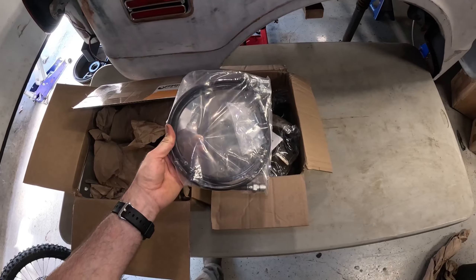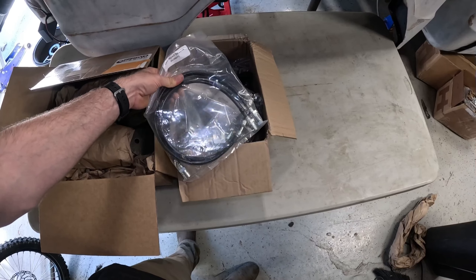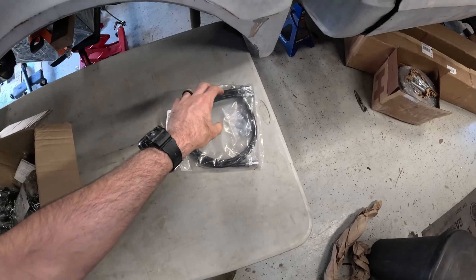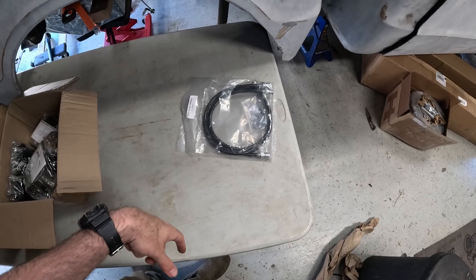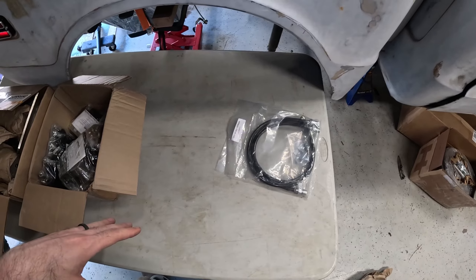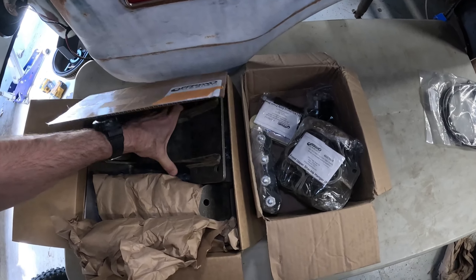We are going to be seeing about six inches of total lift over stock, so we did include some Off-Road Designs extended brake lines — that'll give us the extra travel we need going from the body of the truck and frame down to the axle itself. From there I'm going to be building some custom in-house brake lines that go along the axles themselves, just to make sure we're all good there because I never try to rely on old components when doing stuff like that.